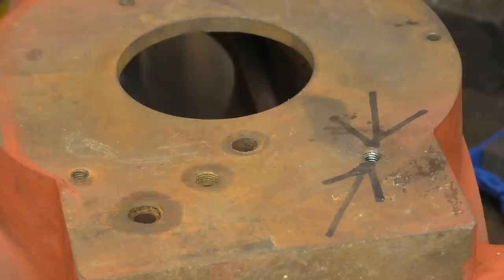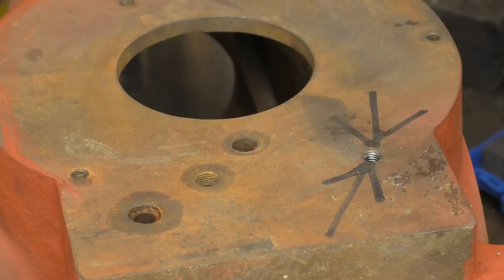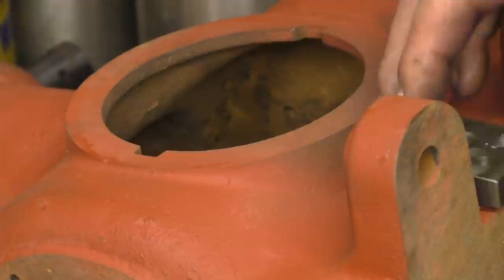I wasn't going to buy a BSF helicoil kit just to do those 5 stud holes that I would never ever use again. I have got a quarter Whitworth one, but that casting is not thick enough for you to put a Whitworth thread in, it will be too short. Right, next these two, which will have to be drilled. So I'll go and find a clamp that I can use to hold that onto there, and then we can drill and sort those two out.